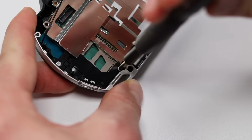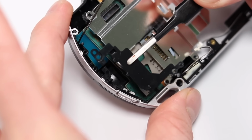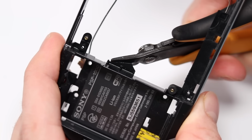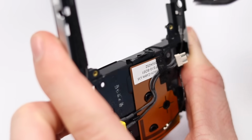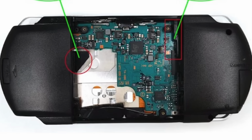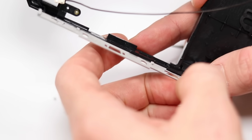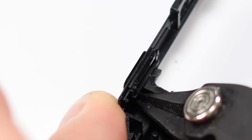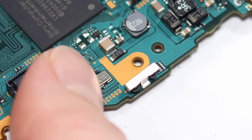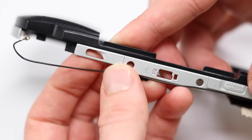Right, and then we have the extremely pleasurable task of reassembling everything. Blindly. Not knowing what needs to go where and why I'm even doing this. You also just have to cut out some plastic. So yeah, this is an irreversible mod, but fortunately that's one thing the instructions do actually show. You also have to remove the infrared sensor, since that's where the HDMI port's gonna go, so just cut that right out. Okay, and let's see what we can actually put back in.